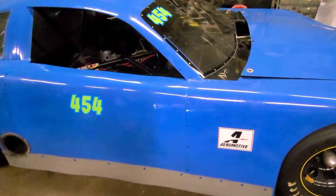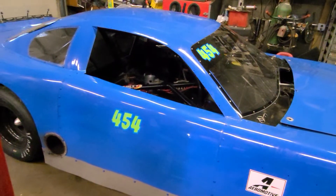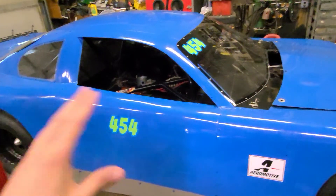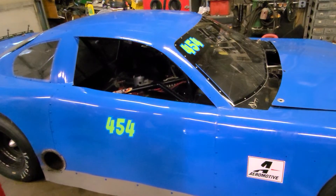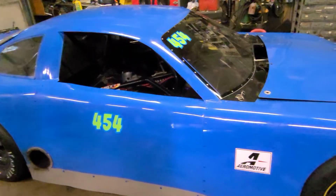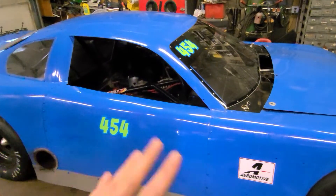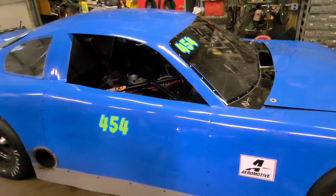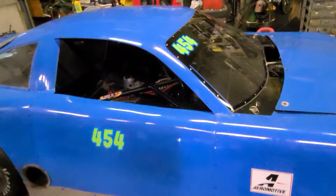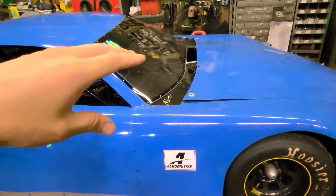Going into the feature, I was really debating whether to put the 225 in the left rear to give more bite off the corner, but I was concerned it would throw off my cross weight, so I decided not to. Another issue was when we started the car for the heat race, it had no accelerator pump — you'd give it throttle and it would just bog. After about a minute it went away, but when I was pulling off the track it stumbled a little bit. So between the heat race and the feature, I pulled the carburetor all apart to figure out what was going on.